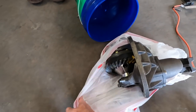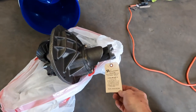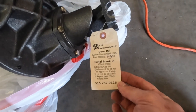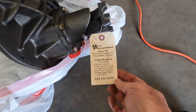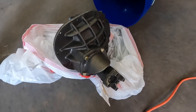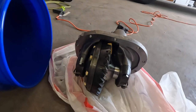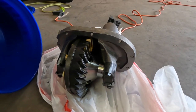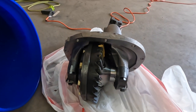This was done by Quick Performance and basically I went online and was able to order everything that I wanted for the rear end. Here's their tag and it tells you basically what oil to use, that you do need a posi additive, and then it has the break-in cycles on it. So all the instructions are very clear on it. You can see everything has been rebuilt and cleaned up. Here's the gears and the posi unit and you can see everything is brand new bearing, brand new everything. So instead of rebuilding the center section that I have, I just decided it would be quicker and easier to order the center section with the posi with the gears that I wanted.